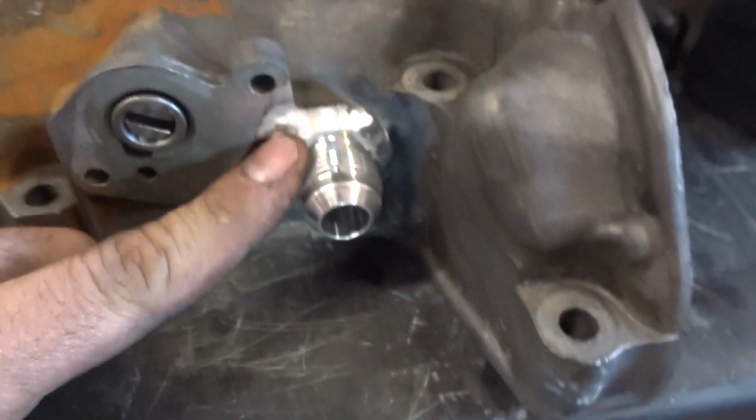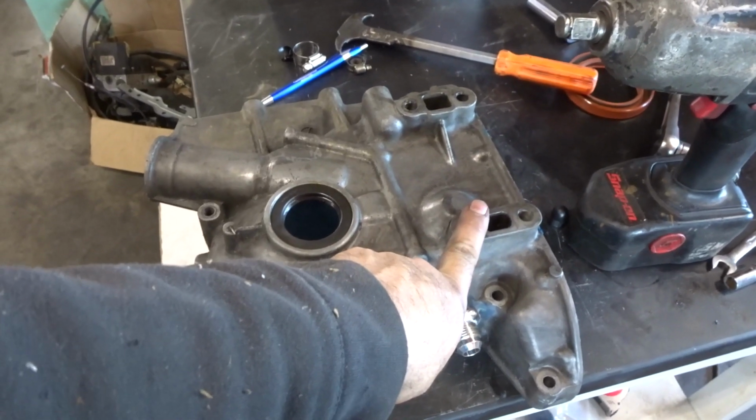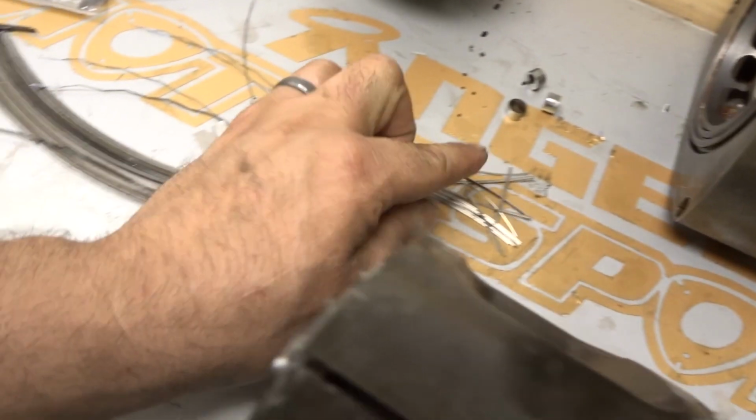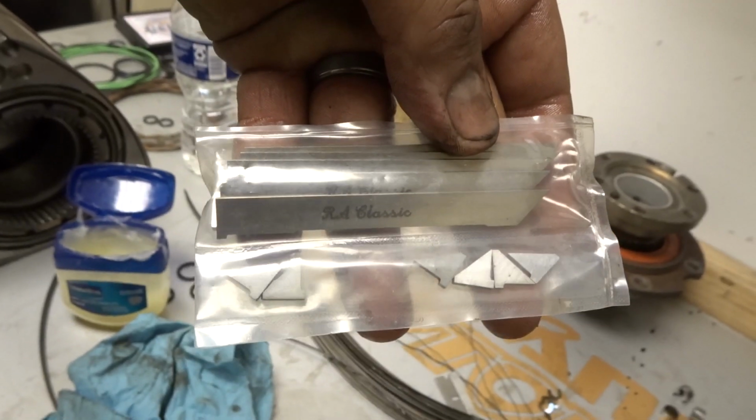All right, we got the bung welded. So this is gonna be the turbo return. The old front cover, we sold with the past engine. So again, we're redoing everything, but that's done. So on this rotor, we have all the side seals put in. Now we just gotta get the Apex seal springs. We always use our Classic Apex seals on our cars. These things are unbreakable. Highly recommend them.